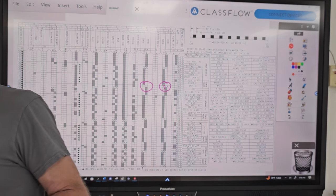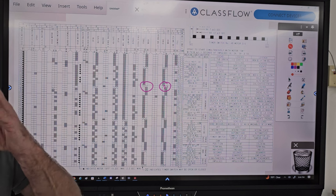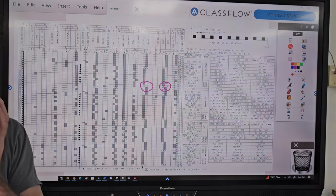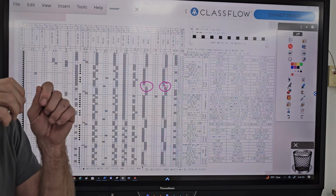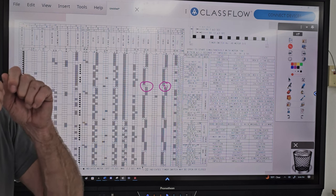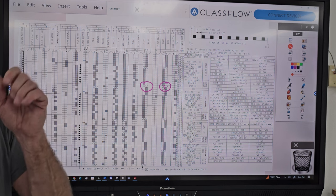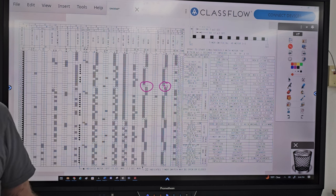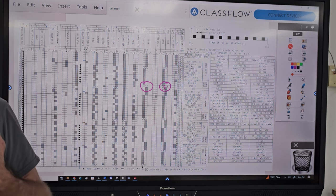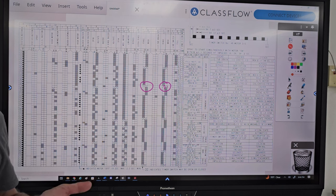Okay, so anyways, it's very difficult to create this physical timer with the cams and have them 100% line up with that paper chart. So it may be a slight degree off on that cam, and the switch may still be physically closed when it should be open or something like that. So that's why they're saying may or may not be closed. If it's closed, it's all right. If it's not closed, it's all right. That's the only thing I can tell you. Okay?